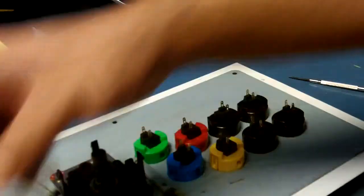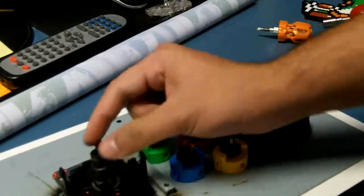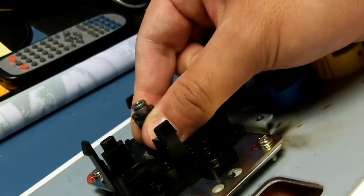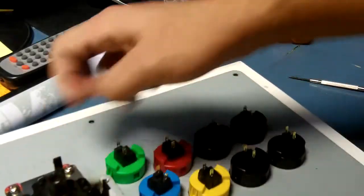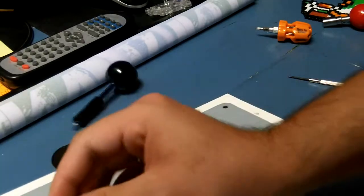Basically now, we want to put the E-clip collar around the actuator through the little slit in the link itself. As you can see, there's a little line right there. That's where the E-clip goes. So let me see if I can figure something out. I'll take the old ball top, stick it under there. Nah, forget it. Alright. Did this last time with just my bare hands, so we'll see how this goes.